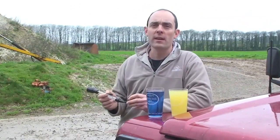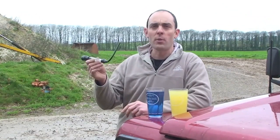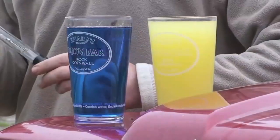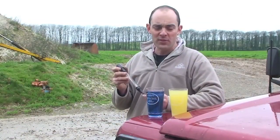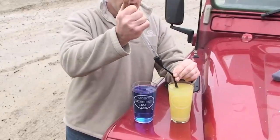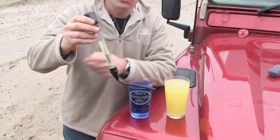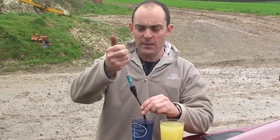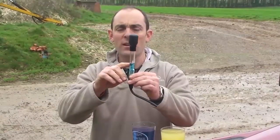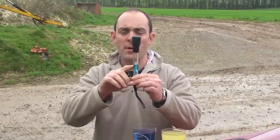What we've got here is a pretty simple piece of kit that could save you a lot of time, hassle and money and frozen engine blocks. It's just a simple antifreeze tester. To demonstrate it, here we have a pint of orange squash and a pint of coolant — a handy way for colour blind people of distinguishing between the two. We'll suck up a bit of orange squash and you can see the float hasn't risen at all. If we test the antifreeze, you'll see the float floats, and on the numbered scale that denotes what temperature it's rated to and what protection it will give.